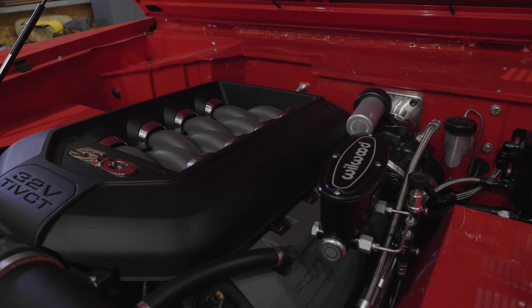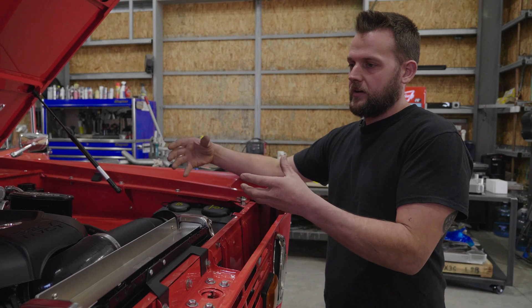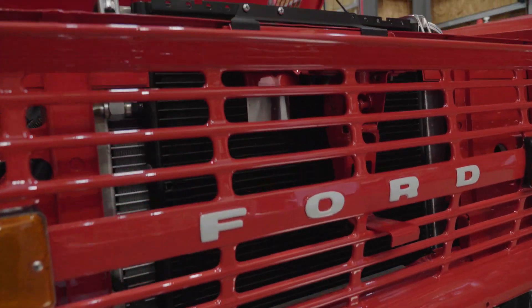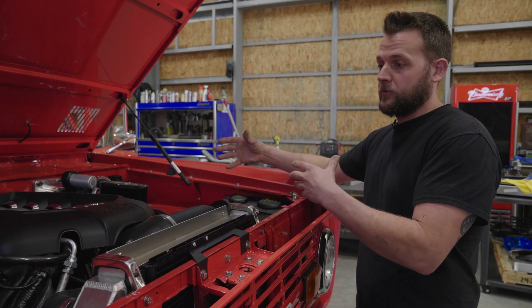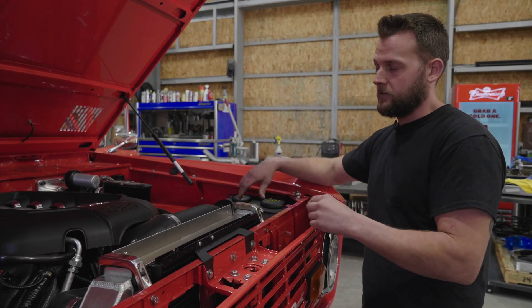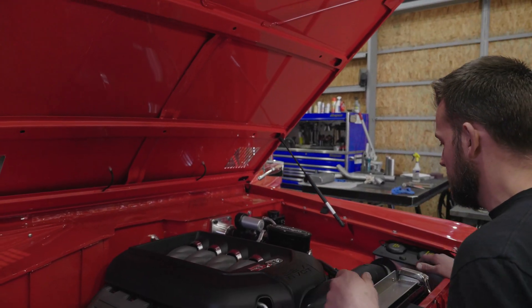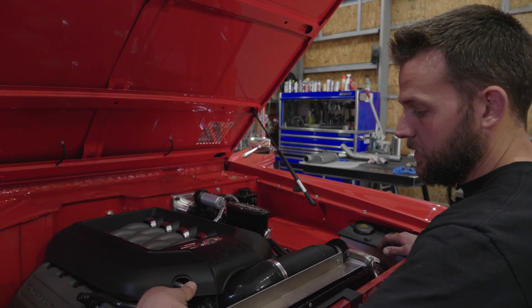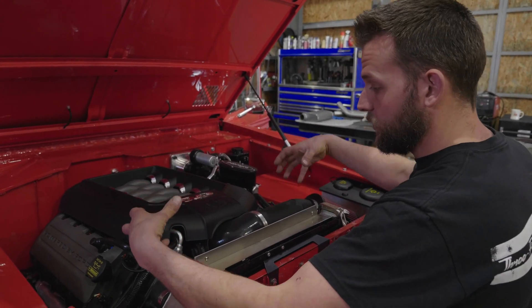This was a big challenge in fitment — it was really my introduction to Broncos as far as complete restorations go. Being that this is a 74 Bronco, the engine bay is very tight, which poses a lot of fitment issues trying to squeeze such a large engine into obviously a very small space. These inner fender wells were trimmed back as far as we could get. We did a BC Broncos front accessory drive kit on this engine, which allowed a little more space between the radiator and the front of the motor, but everything's still really packed and tight.